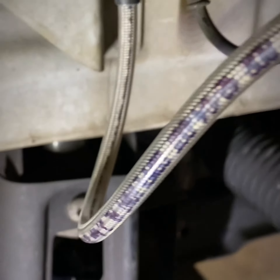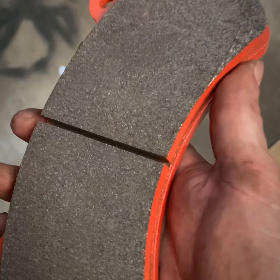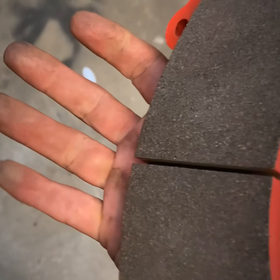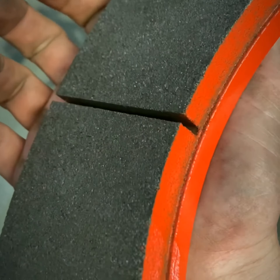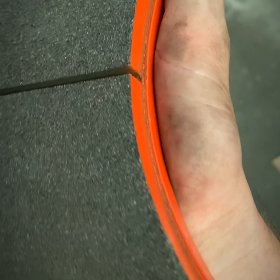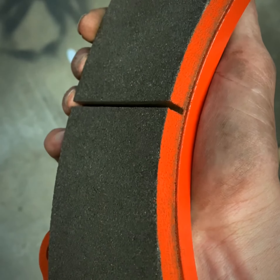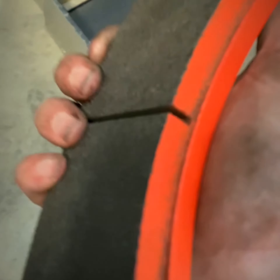Best thing you can do right there on the braided brake line. Unfortunately, the Zerco brake pads that I specced for this — overall when it sits in the caliper, it's about two mil too wide to fit over the disc. It will go on the disc, but what will happen is the disc will obviously heat up really quickly while it's trying to burn off the top layer, and it'll just glaze the disc and glaze the pad as well. So it's no good — I'm gonna have to sand these down a bit, so let's see how that goes.